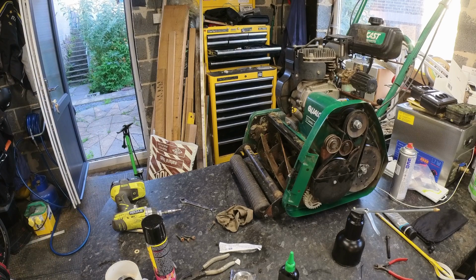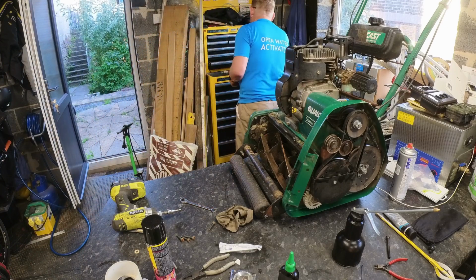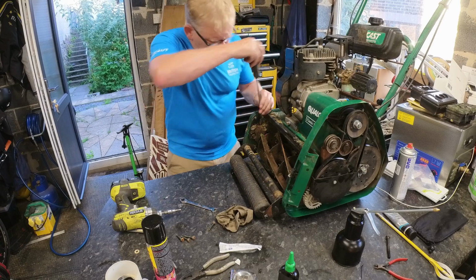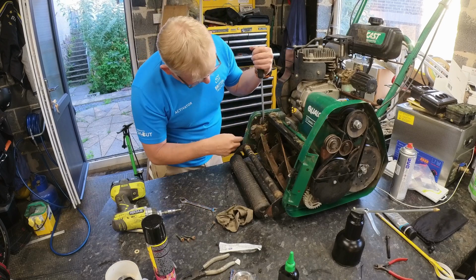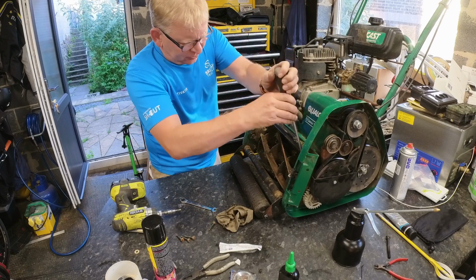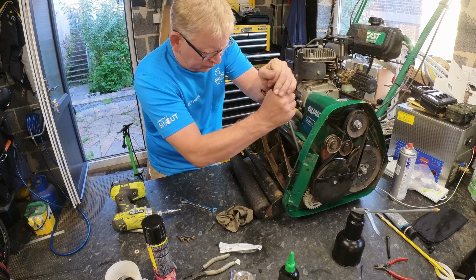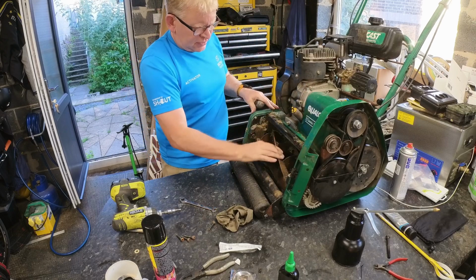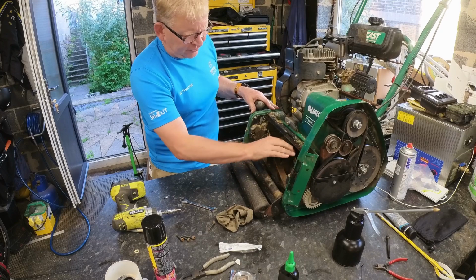So just cap off a high pressure. Right, so just slacken this off so it's a bit spreadable. Big screwdriver. So there's two screws in here, and when you wind them down, it either pulls it up or pulls it down, and it's the plate underneath. So I'm going to find out now whether I've remembered it's the right way around. I think you undo them to make it slacker. Yeah. You can still hear it's grating, so I think somebody's had that too tight.